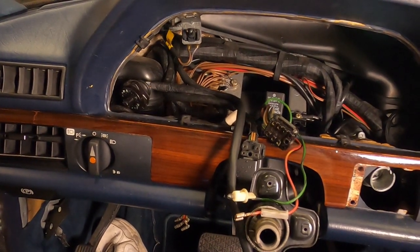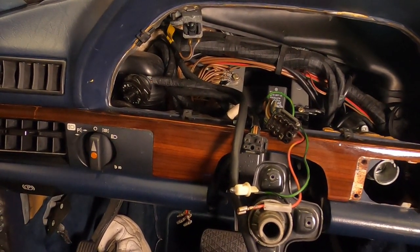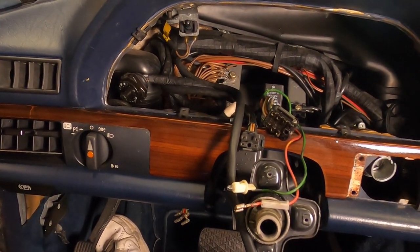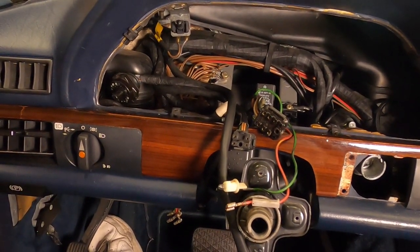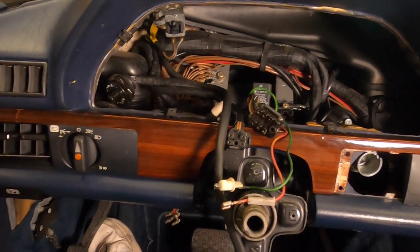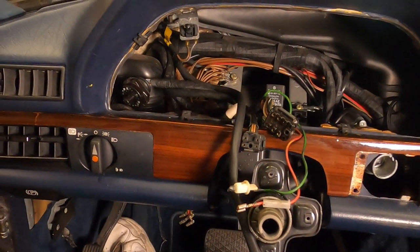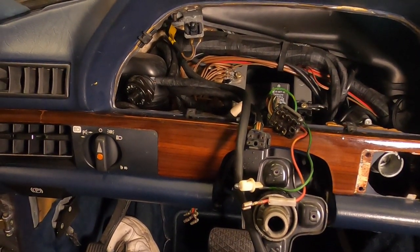The bottom steering spindle corrugated tube is extremely sensitive to lateral forces. For this reason, move jacket tube out of position carefully and as little as possible. Okay. Loosen hex head bolts on the upper mount for jacket tube. Okay. Pull jacket tube downward slightly to remove and reinstall the steering wheel lock.